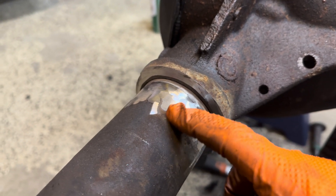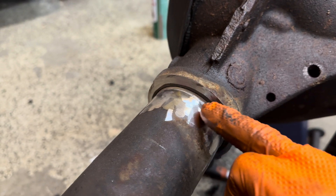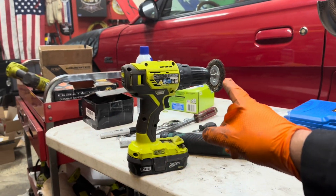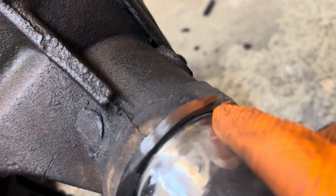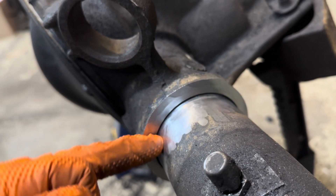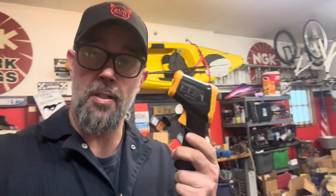What I'm trying to do is clean this part of the metal and the ring around here where it's not cleaned up. You can see there's a slight air gap right between the tube and the housing. I'm going through with a flap wheel and then this little wire brush to get down into the gap. This side is really clean — no debris. The other side had more gunk and the wire wheel did a good job clearing it out so you get a nice clean weld. Once it's all cleaned up all you can see around here is the air gap — all the crap is gone, nice and clean, ready to weld.